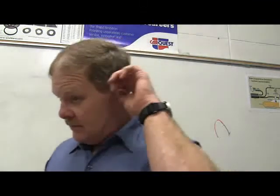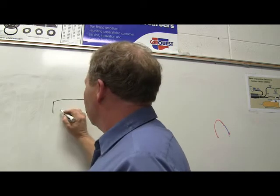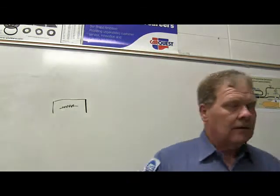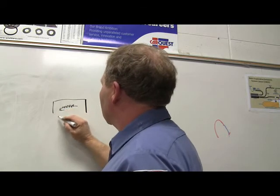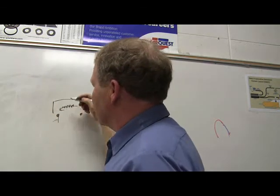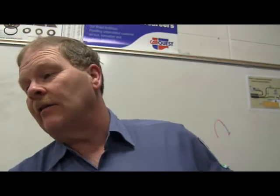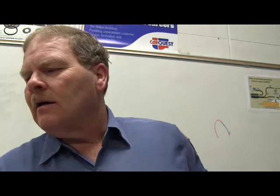All right. Now then, that's the instrument voltage regulator. Basically, it's got a bimetal thing in it. It's acting kind of like a circuit breaker. It's grounded here, and it's got power going through it and coming out, and it's going to have a flashing signal that it sends out because that bimetal strip is going to move back and forth as it heats and cools, like a circuit breaker or a turn signal flasher almost, except it's just a real slow, gentle pulse.